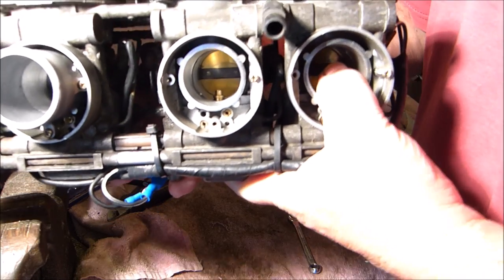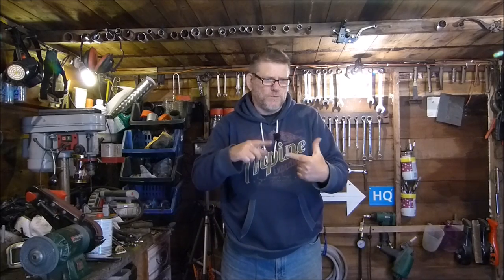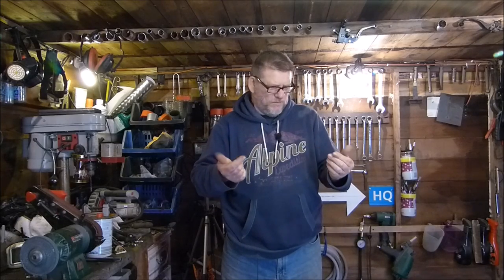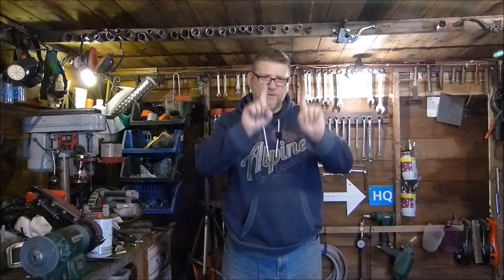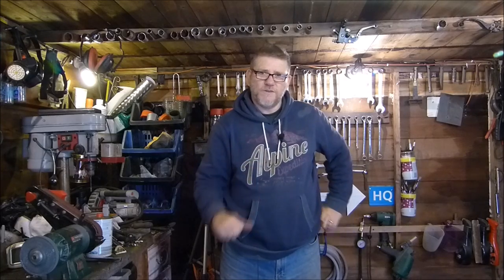This carburetor was the same, but I've managed to take it out. When I very first cleaned those carburetors out, nearly 2 years ago, I undid those two screws from inside the carburetor float bowl, looked at them, they're pretty clean, they don't look like they do anything. So I just shoved them back in, tightened them up. And obviously, I didn't make sure the two brass things were seated in properly.